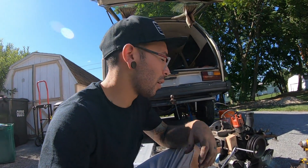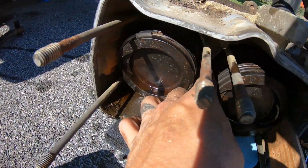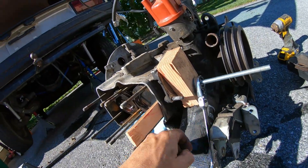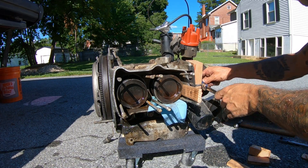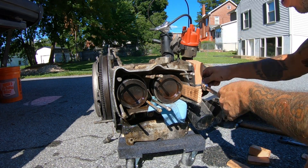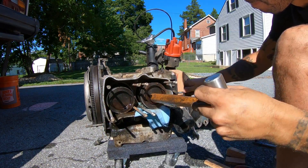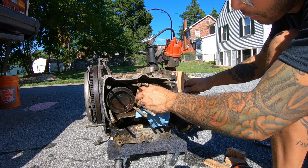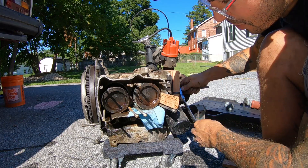Feeling quite defeated — I've been trying to pull the wrist pin out of the piston itself. I was able to get the snap ring out no issue whatsoever, but they're just really really seized in there. So I developed this rig: some regular all-thread with a nut on the inside that's gonna get sucked in when I pull this. First time doing a job like this and I'm just worried about further breaking things. So far no noise — we are getting resistance. Scared the living hell out of me — there's a wrist pin. Let's go for another.